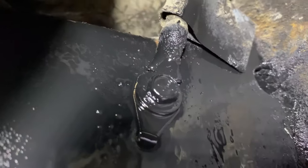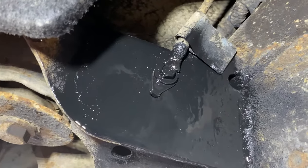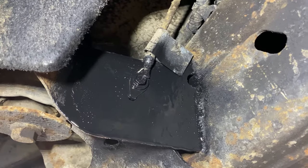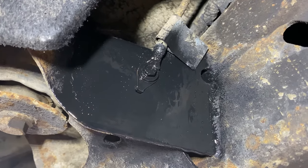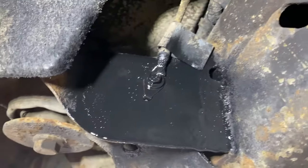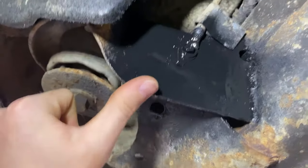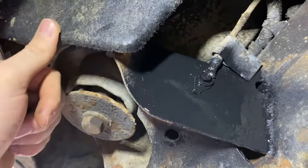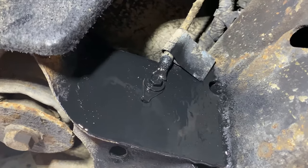I also went ahead and sanded down the bottom side of that bolt, put it back together, and spray painted it so no rust will come back from the sanded spots. Now I'm going to go ahead and reconnect the battery and make sure that's nice and tight. Hopefully this fixes the problem — these are the two main grounds that interfere with the ignition. The one inside that I fixed is the ground for the ignition, and this one is the battery ground. Hopefully that fixes both of those problems.